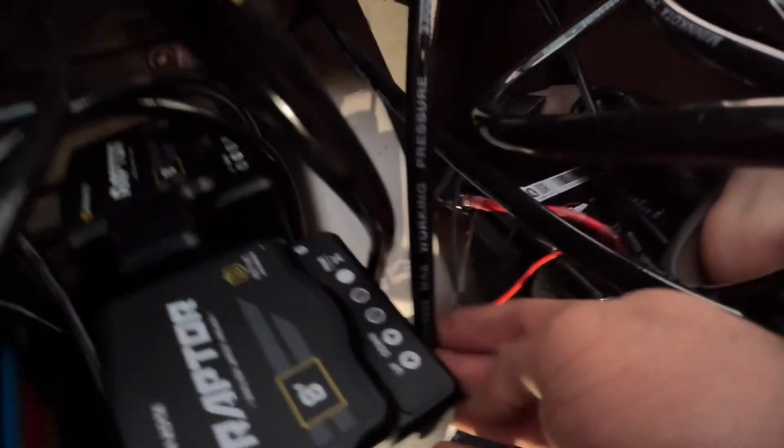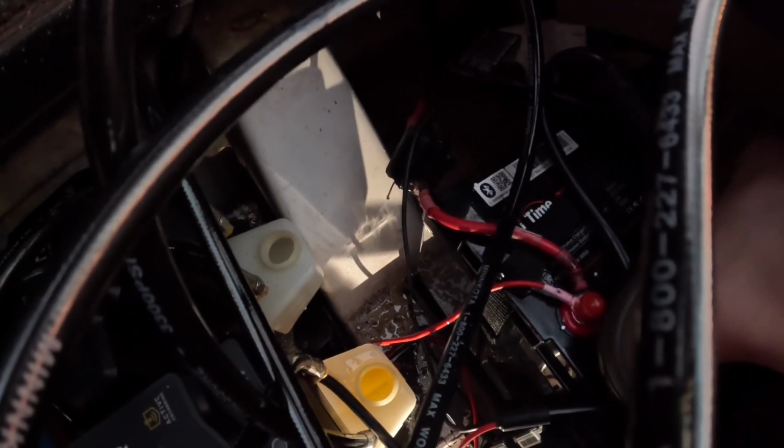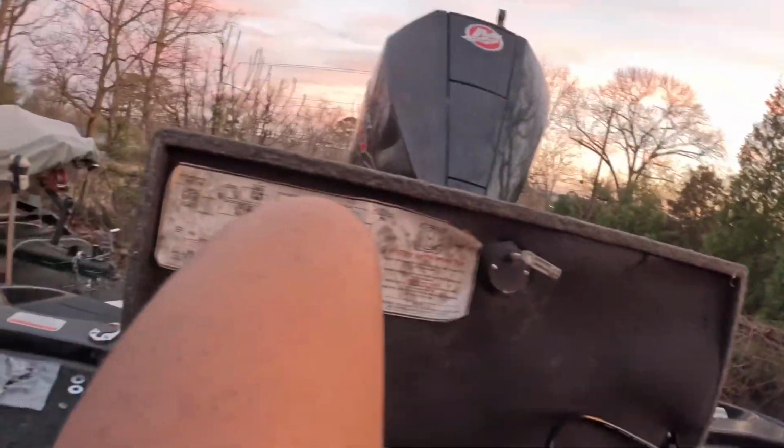So now I'm gonna power it on, and sorry for all these wires, but as you can see, they're on now. So I'm gonna go up, and you can see the fluid drain actually when I do this. So watch. The hydraulic fluid went away. Keep going up. And now I'm going to add more hydraulic fluid because it's getting low. Like I said, you want to keep adding fluid. Don't let it get dry because then more air will get in there, and that's bad.